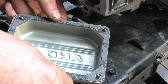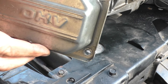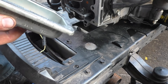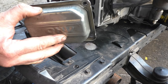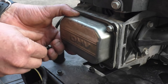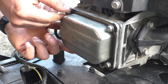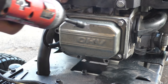Now I just put the gasket on the valve cover — it's going to stick to the gasket maker. When you put the cover on, make sure you have it positioned properly, because if you don't, the model, type, and code numbers will be facing downwards and it's going to be impossible to see the proper model numbers if you ever need parts.